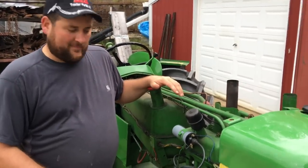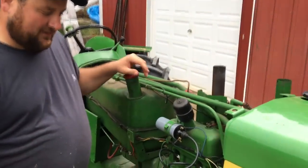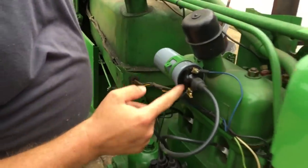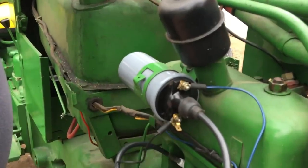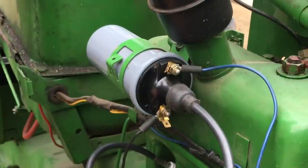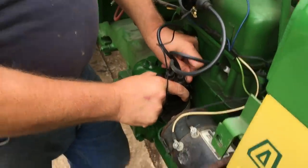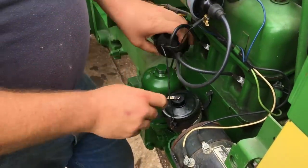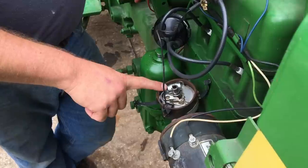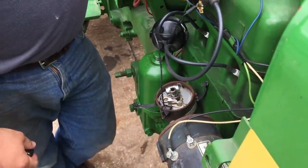After taking the hood off — it's much easier to do this with the hood off — you'll see the ignition coil was recently replaced due to a faulty one that was leaking oil. You'll notice the positive terminal, since this is a positive ground system, is the one that goes down to our distributor, and the negative is the input side coming from the ignition switch. For this application we'll be changing the ignition coil to the Flamethrower version for more voltage, and we'll be removing the breaker points and condenser from the system.